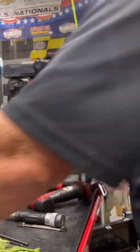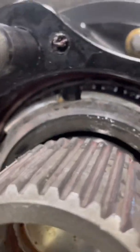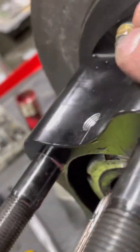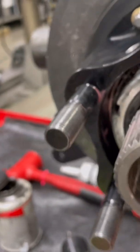I run that locking nut in and torque it hard, spin it a couple times, then un-torque it, spin it, torque it again, spin it again — that's my setting. It's up against that solid crush sleeve, so when it's right it's not too loose and not too tight. When you crank from medium tight to full tight and it doesn't change the amount of friction to turn that hub, you know the sleeve is correct. Next I lock that nut into place with two small allen bolts that have a little plastic on the end — those lock the nut against the spindle threads. There's an access hole through the hub to tighten those allens, one on each side of the nut.